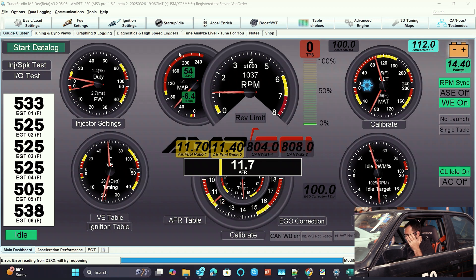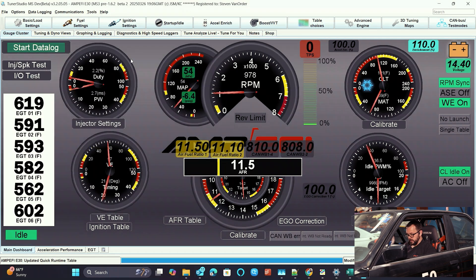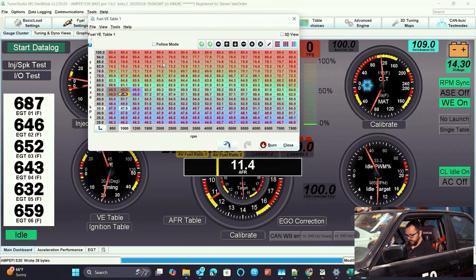That's not too bad for just using a VE table generator with some predefined values. The engine is still relatively cold here — 95 degrees. Cold start went well. Now you can see that we are fairly rich, but our warm-up enrichment value is not really very high — it's only adding about 10% fuel. The VE table shows a value of around 54-57. When I generated the VE table I put in an idle KPA value of around 45, but I may have been a little off — our KPA value here is 50-55. So I'm going to set these values to 45, pull fuel out of it, and see how this affects the idle.